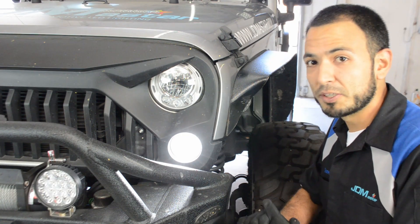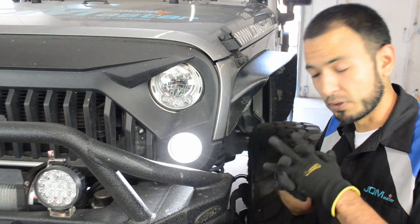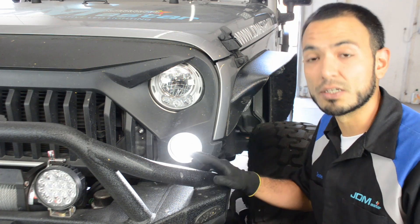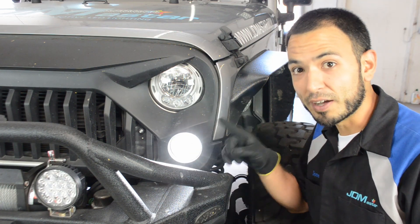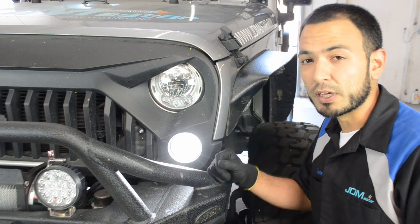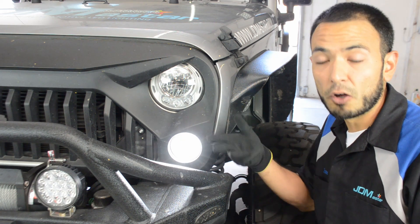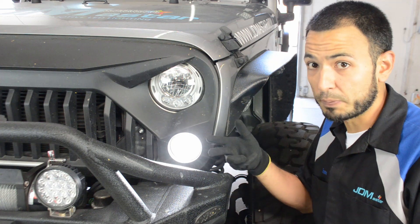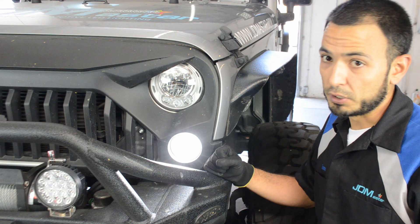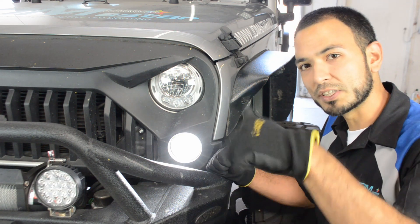That was a comparison between our best three selling switchback bulbs. Just a couple things to look out for if you're looking to replace your front turn signals with switchbacks. First of all, verify your size — look at your owner's manual and look at your stock bulb by pulling it out, and that'll help you confirm which size switchback bulb to go for. Second, the largest factor that'll determine which switchback bulb you'd go for would more than likely be the intensity difference. And of course, if you ever have any questions on which ones work best, give us a call or leave us a comment below.